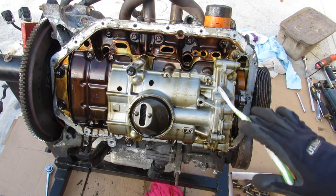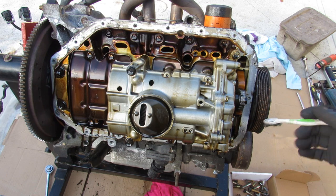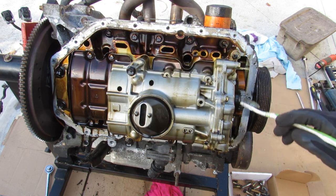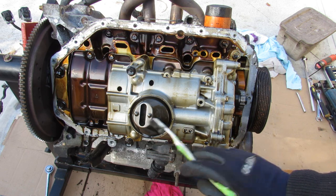The K-series has a mechanical oil pump, but instead of driving it directly off of the crankshaft like a J-series V6, they put it down inside of the oil pan. That's why the oil pan is so deep — it integrates this oil pump inside, driven off of the timing chain from the crankshaft, and also integrates the oil pickup tube.